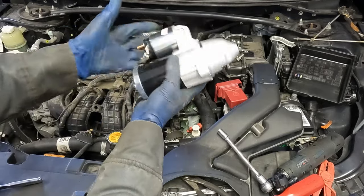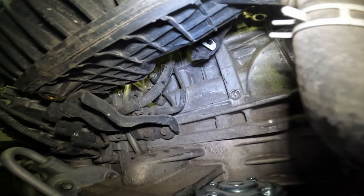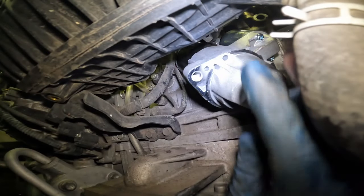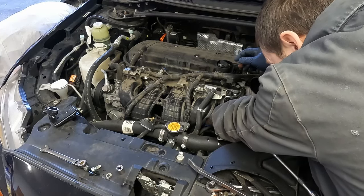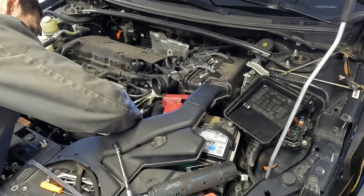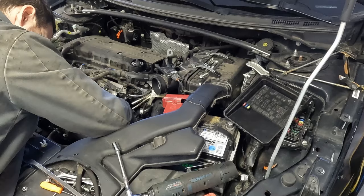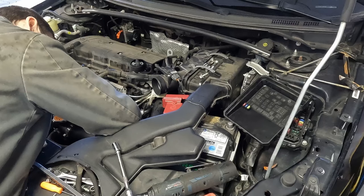Let's go underneath. We'll snake this in and then we'll put on our main power and plug in our S-terminal. We're going to put it in like this. Hopefully that'll stay in place for us. Then we'll go up top, get our main power feed on and our S-terminal, then come back down and put it in the bell housing. Reach my hand down there — just get it started. All we can do is our best for torque. Toss our S-terminal on. Make sure our boot is over our cable.